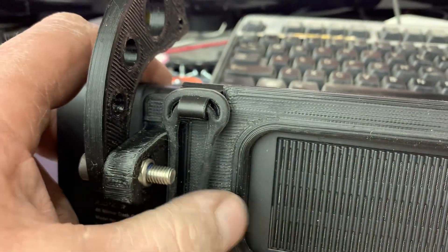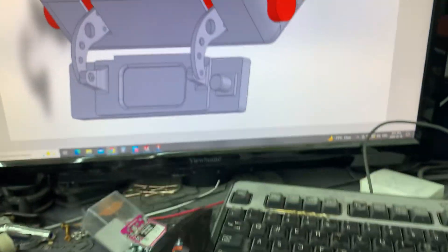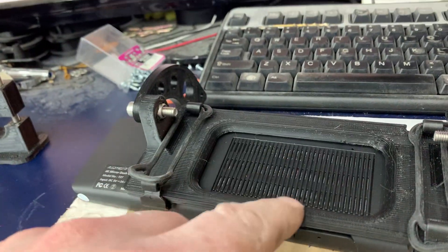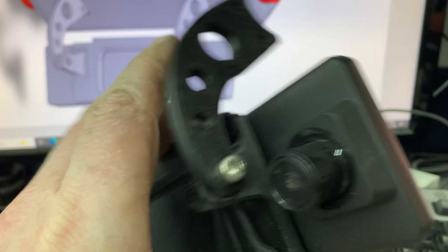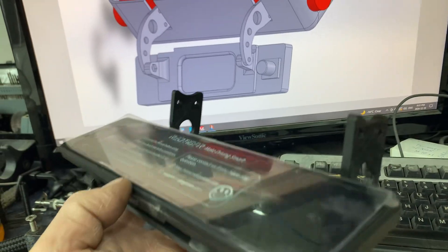We've done this design which incorporates the rubberized mountings — we'll see how long they last, but I can unbolt and change that. I've printed the brackets that mount to the cage for now, only because I want to make sure the mirror is in the best viewing position with the least amount of distraction. I've sunk some hexagons into the plastic so we can just press a nut in there. Eventually these brackets will be quarter-inch-thick billet, but only once I'm happy with the mirror position.